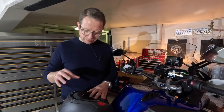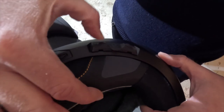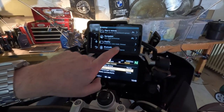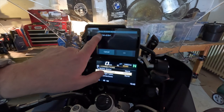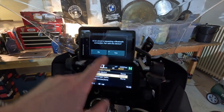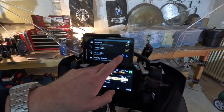Now we want to pair the helmet with the Navigator using the second phone pairing. Again press the plus button and hold it for about 10 seconds, then press once, twice, three times — that's where we want to be. Go into your Navigator, press Settings, then Bluetooth, then Scan for Devices. It should find the SC1A. Press OK to confirm. Your headset is paired. Make sure it shows both Media and Headset — that is correct.